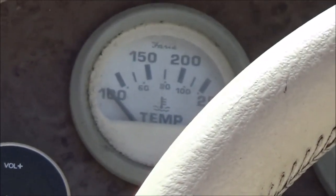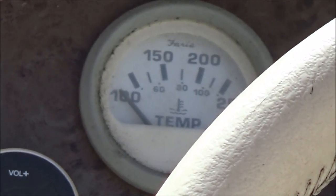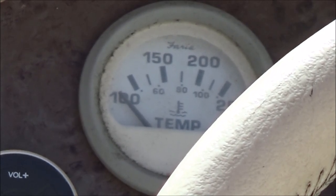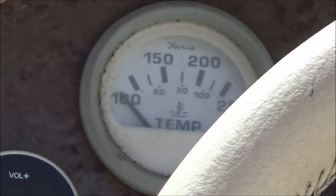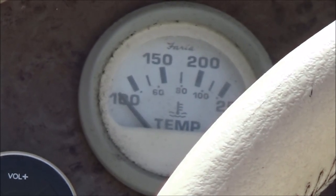I knew this zoom would come in handy. Alright, keys on, we're zoomed in. Now I'm going to take the wire and ground it to somewhere on the engine casing. That works — the gauge pegged right up.